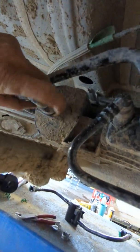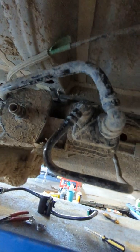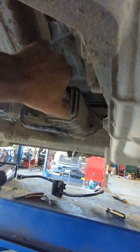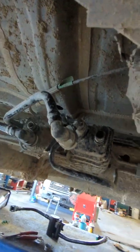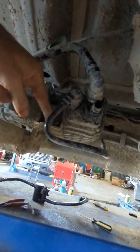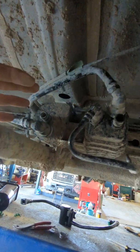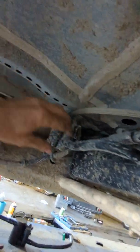These clips right here are push-button clips — you push them in, kind of twist and pull, and they'll come right out. After you get all these hoses off, there's a 13-millimeter bolt right here. You take that bolt out and the canister will slide right out.